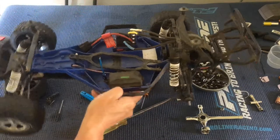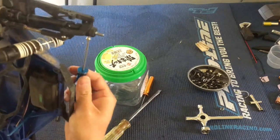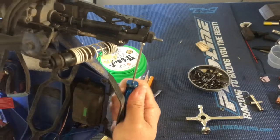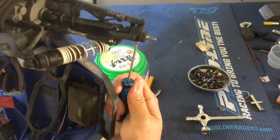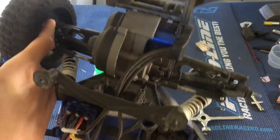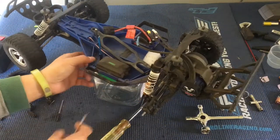This is a pretty coarsely threaded screw. What I like to do is back them out a little bit first to make sure I'm not cross-threading the screw into the plastic. The fix for the other side backing out would be to flip-flop that screw — screw it in from the back versus the front so that it doesn't back out.